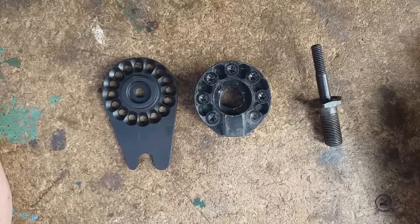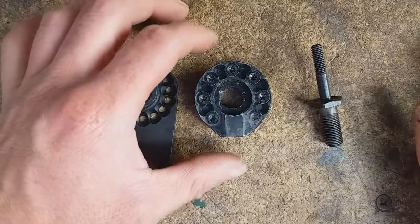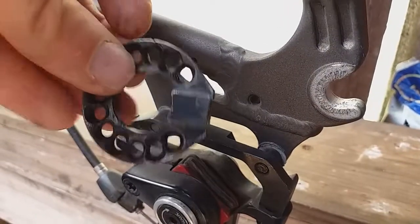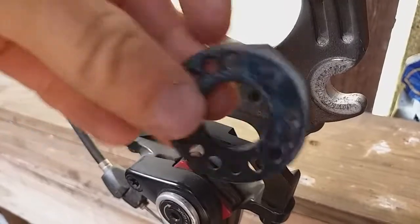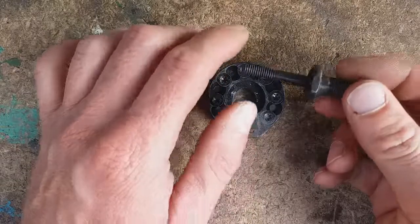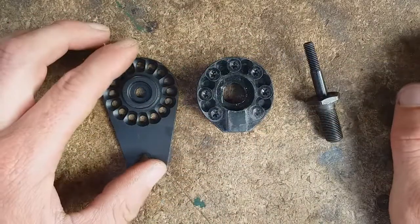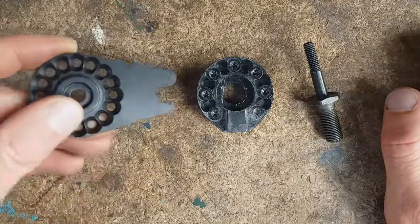The next challenge is to get a no-turn washer that's going to work. The bike has very shallow vertical dropouts, and a standard no-turn washer for a dropout obviously won't work. It's going to use these axle adapters which are meant to fit like that. Fortunately the bike does have disc brakes, so it can use a no-turn washer such as this one.